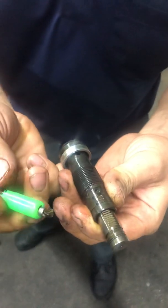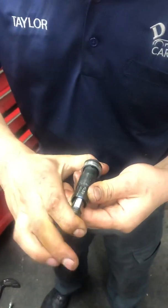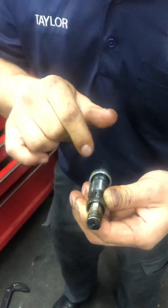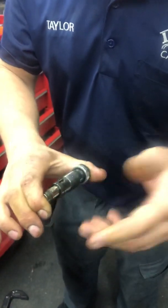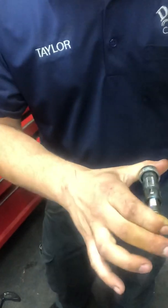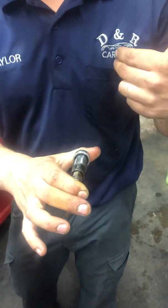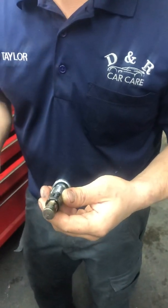Well, sometimes you have to use a magnet, if I can find one. Oh, here we go. Take the teeth out like that. There you go. Don't drop it because you'll lose it. Now the tensioner will push back in. There's no way to keep this tensioner from popping back out once you take the teeth out. And if you've already put a new one in and did the reverse chain removal to put pressure on it to pop it back out, you're not going to get it back.